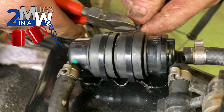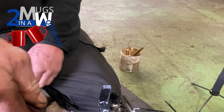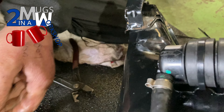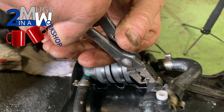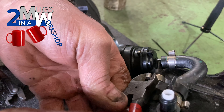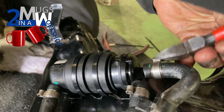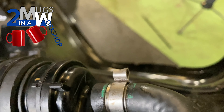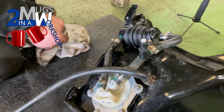They just clamp around the bracket on the underneath of the tank — a fairly basic setup. All you want is a pair of pliers. Three ear clamps, just clamp them together. Now that we've parted those clamps slightly by wiggling them, just give them a good old squeeze. Then use a standard pair of pliers as well if you want to be belt-and-braces about it — squeeze with the ear clamp pliers and then another squeeze with a set of cutters. There's absolutely no gap whatsoever — they're going nowhere, absolutely rock solid. New fuel filter is on.